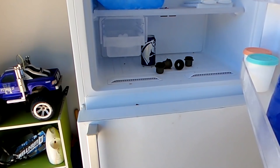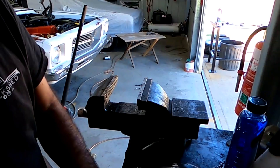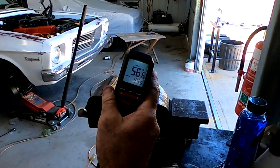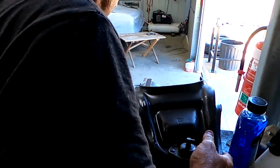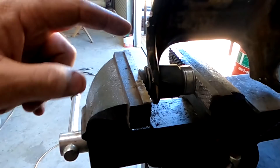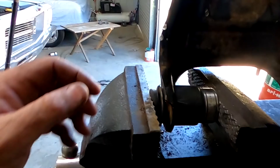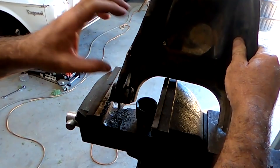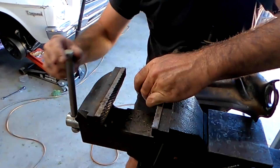Let's see how cold these bushes are. We're just going to get two done, two pressed in, then we'll do the other two on the other side. There's the control arm, there's the bushes. To give you an idea, it's 56 degrees outside and 16.4 for the bushes out of the freezer. I found it hard to film and have both hands on that. I should have a bigger socket over the top of this rubber so I'm not squeezing it, but I don't have one. So I've used the socket to hold the back of the control arm and push the bush into the socket. Don't use too small a socket and get that stuck either.